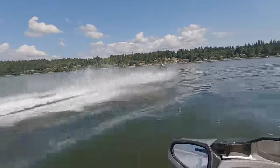I mean, that'll definitely make it vibrate. This didn't put a rock through it. It just broke that vane off. That's freaking weird. Impeller removed from the jet pump. There are no marks on it from passing something through the pump, but it did chip that section off.